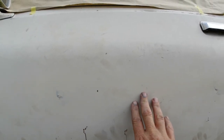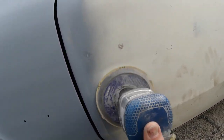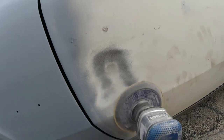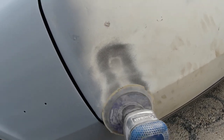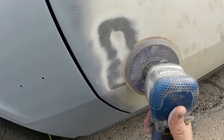This door, if you watch my previous episodes, I changed this door out. So it has little rivets here that I might have to grind down for the molding. The door that this came off had a side molding. I know where the big dings are, a couple right here, so we'll just sand some of these down. See where that dent is right there, and just use your sander, dig in the middle of it to prep it.